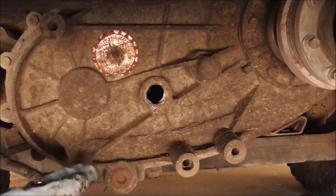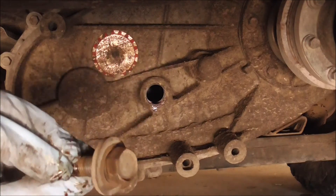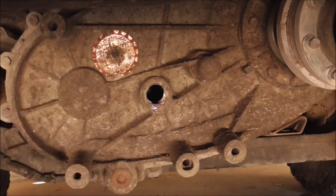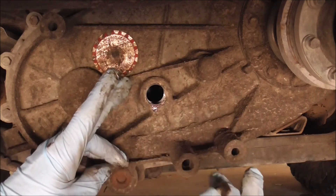In this case I had the skid plate off, so you might have a little bit more trouble, but it shouldn't be that difficult. The skid plate has four bolts that hold it on. If you want to take them off it's 18 millimeter, but I don't think it's necessarily something you have to do. You can just go ahead and take this top one off, check it real quick, and be done.